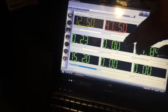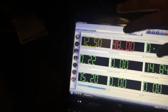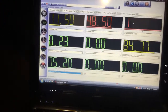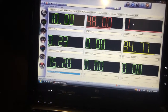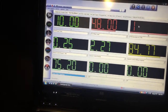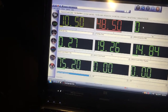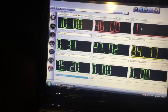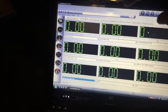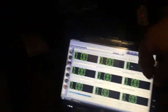What you'll notice is ICP pressure will build to above 500 pounds, but the truck still won't start — I'll explain that in a second. FICM sync went to 1, and IPR percentage will drop down once it reaches 500 pounds, but it still won't start. Let me try to get it to that point. You can hear the fuel pump coming on, but the batteries are just toast.